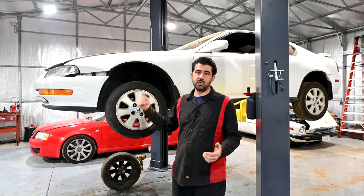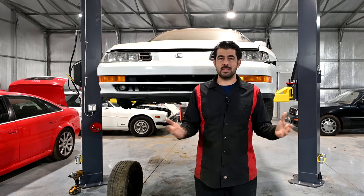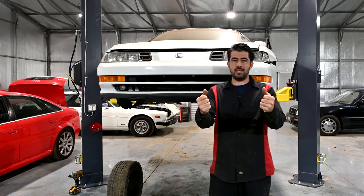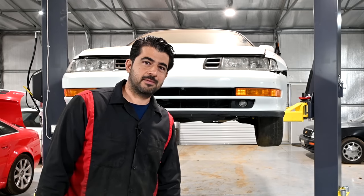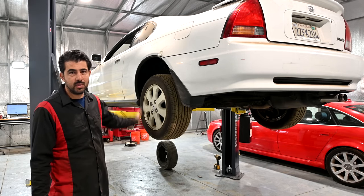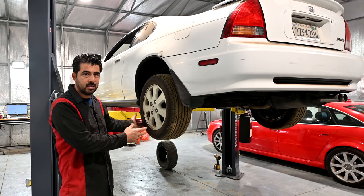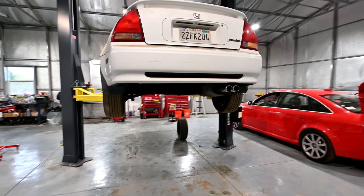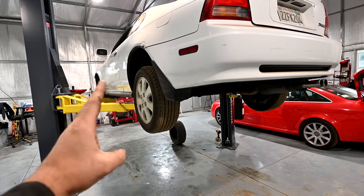Now, let's assume this is a rear wheel drive Ford Mustang GT on this lift. Those guys like to oversteer — rear wheel drive vehicles tend to oversteer, unlike front wheel drive vehicles that tend to understeer. Oversteering means you turn the wheel, make a right, but then you make another right and oversteer. On rear wheel drive vehicles, all the power goes to the rear wheels. The torque going to those tires can cause you to lose traction on the rear wheels, spin out, and cause oversteering. To remedy that, on rear wheel drive vehicles it's best to have more negative camber on the rear wheels and less on the front.